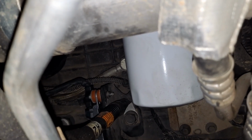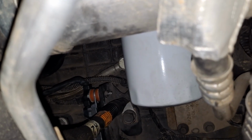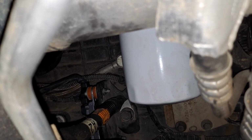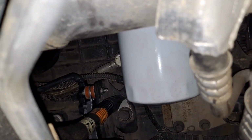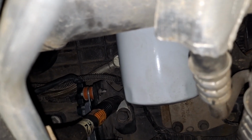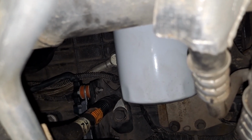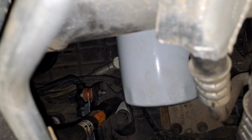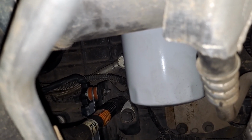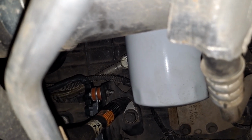One thing that I did was put the stud and the insulating mounts through the bracket, and then I put an O-ring on the back side of that stud so that it would hold all that in when I go to put the assembly into the bracket. That way you're not fighting these things falling out, and when they fall out, they go in all different directions. So just a little trick there: put a little O-ring on the stud to keep the assembly together.